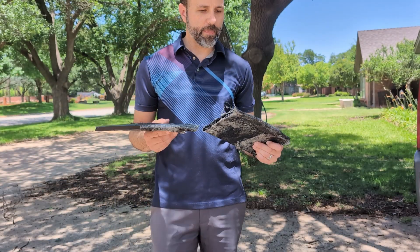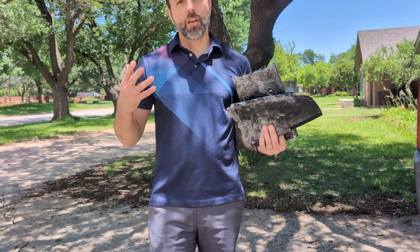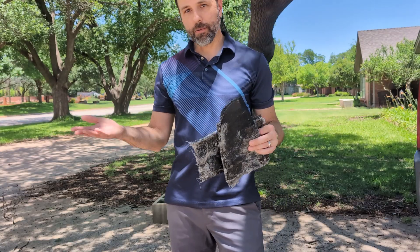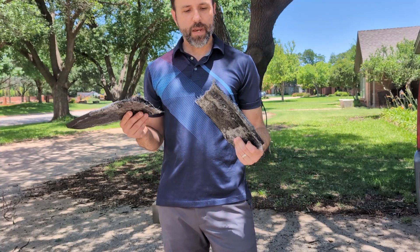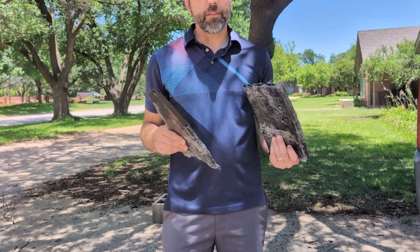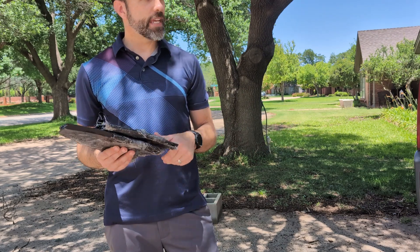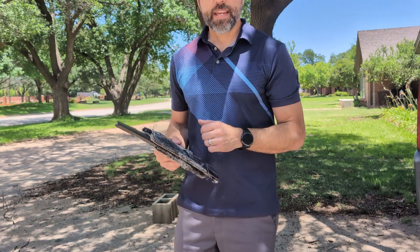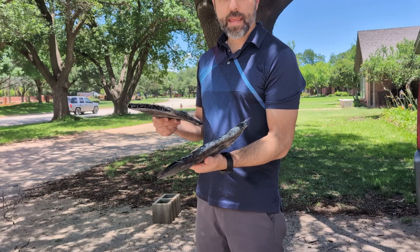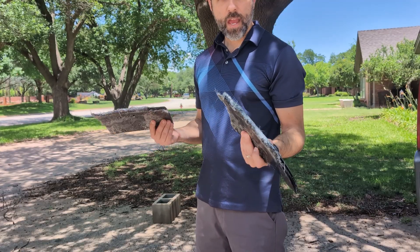I think this has a lot of applications — people doing wide body kits and spoilers who don't want to pull them, or you print a part, take a mold off that print, and then fiberglass or carbon fiber it. This saves steps, money, and time. The Miata community — a lot of people have 3D printed hard tops — I think this is a good solution for that. Going forward, my plan on my XKSS D-Type build is to put a thin layer on the outside and the inside. It shouldn't add much weight, but it obviously has significant strength. I hope this has helped y'all.